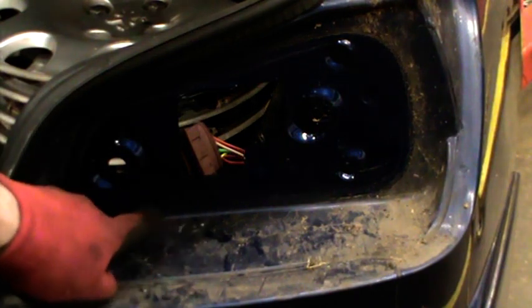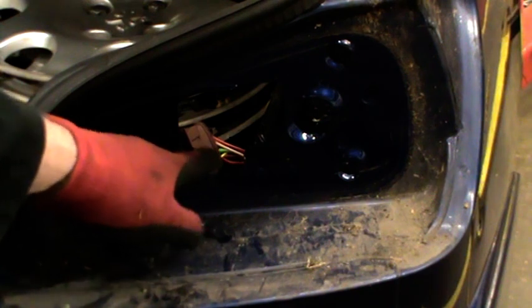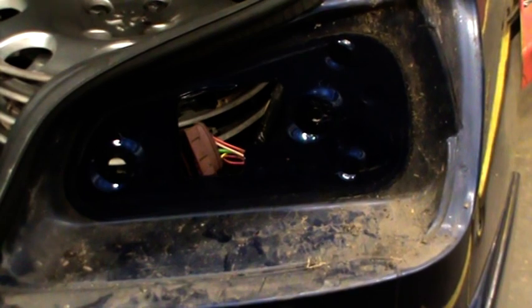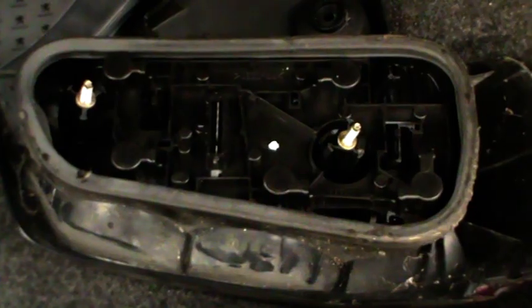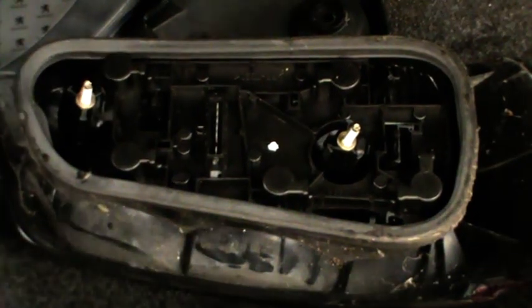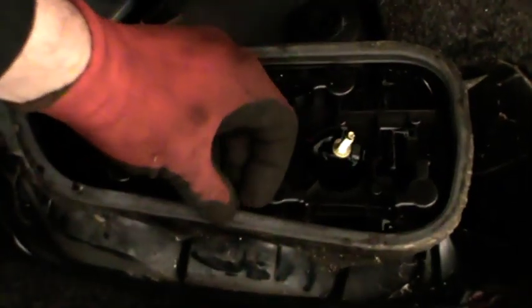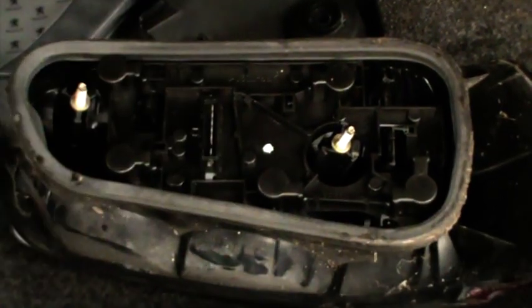As you can see, the lens is now removed from the car. The actual lens itself does create the weather seal for the back of the vehicle, so it's really important that the light goes back in properly - otherwise this area won't have its seal and we will start to get water ingress through here into the back of the car. Here you can see the back of the lens with the actual weather seal. It's really important that you check that it's intact, fitted properly, and is in good condition - no holes or anything like that.